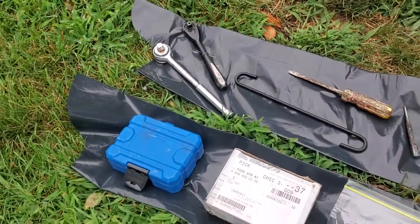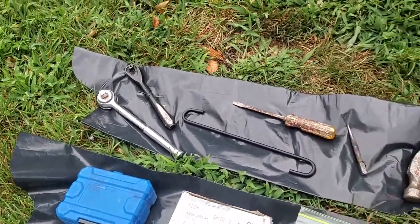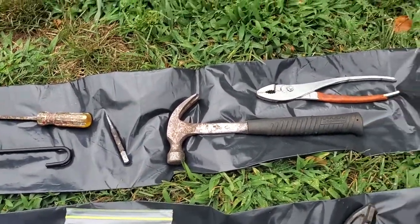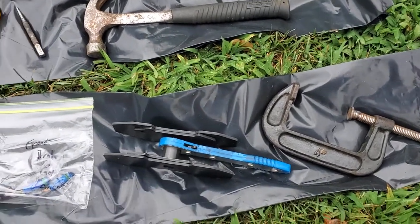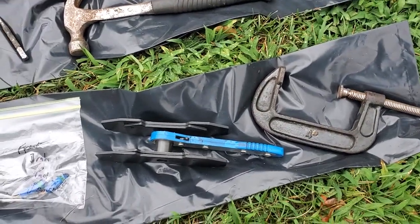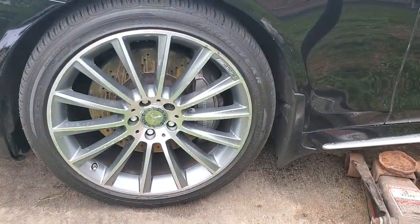These are the various tools that you're going to need — you won't use all of them but some of them. Starting from here: this is a star point ratchet, you have the half inch ratchet, a 3/8 screwdriver. This piece I got from Home Depot in the garden section — that's going to hang my caliper while I work. You have the hammer, this little knockout tool for the pins, and your C-clamp which is universal. You also have a compressor for the piston which is superior to the C-clamp. The C-clamp is good for your front brake pads but not for your rear brake pads. And of course you'll want your own ratchet set. Let's get started and jack up this car.